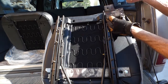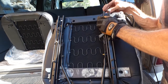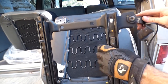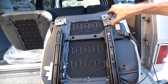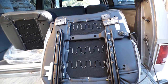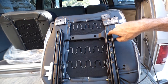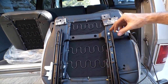Alright, so sorry I had to weld these things together. I just couldn't seem to make it work with one big piece. Okay, well, I ran into another problem. When I was trying to bolt this stud through my bracket here, I didn't have enough thread length. The stud is tapered just a little bit on the end. So I had to pop that stud out, and I put in a regular flanged bolt in there.